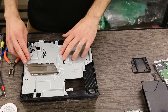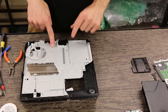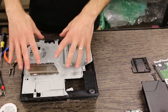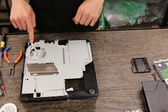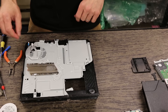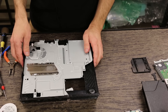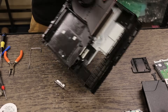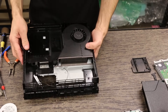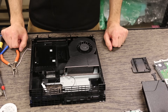The last thing is if you're going to remove the fan, you remove this screw, this screw, and this screw just like on the old style. Then this pulls up and there's one screw here for the fan. The fan just pulls up just like the old style and you put the new one in and put it all back together. That is the new model of PS4, the 1215A, and that's the teardown for it. If you guys have any questions at all, please let us know and we'll help you out however we can.